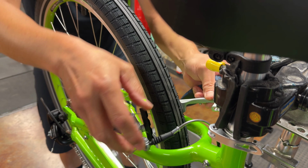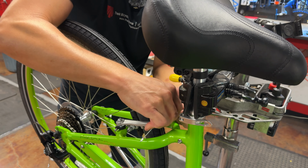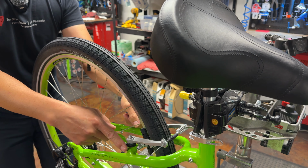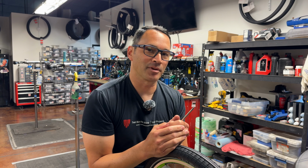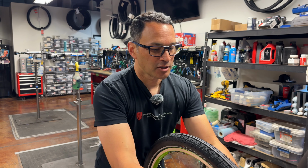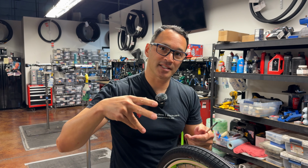Okay. Oh, yeah, you can hear that snap back into place. It really does. Now, what's going to be hard is if those springs are the fine tuning. If you don't have that fine tuning and you're just bending springs, it might be a little difficult to get them squared up. So that's getting some friction out of the line, making the lever feel nice and snappy.